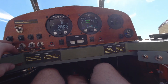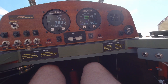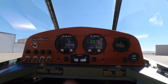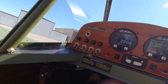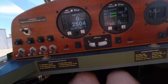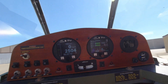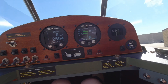After shutdown we checked the instruments. Oil temperature went up to 105 after we turned the engine off. RPM came alive, CHT came alive, EGT came alive — but oil pressure and oil temperature did not respond during the run. It took about 40% throttle to start it, then the throttle was pulled back to idle once it started.